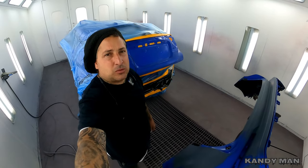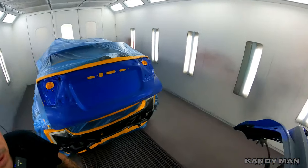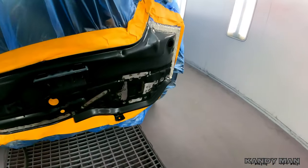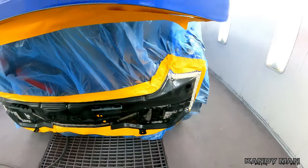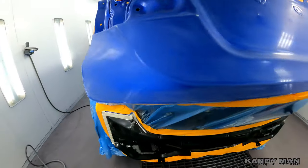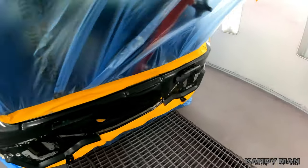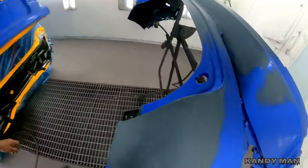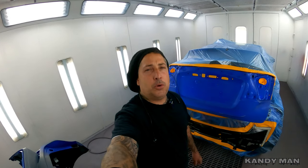This is the next one we got loaded. You see me bag it up — it's a rear body panel, a new rear body panel we put in, all nice resistance welded and seam sealed up. We're doing the tailgate with it, and you can see how I have it propped up so I can do it all at one time and do it right. We got the bumper to shoot with it too. I'm going to shoot this one and I got one more for the day over in the other booth — a big job where we put a quarter on and we're doing the unibody side.